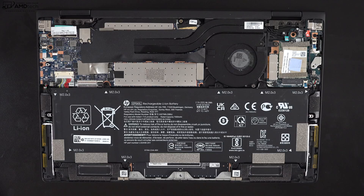The laptop has a four-cell 56-watt-hour battery. My continuous web surfing test over Wi-Fi at 150 nits gave 11 hours and 4 minutes, meaning in real-world mixed usage you're looking at around eight to nine hours depending on what you're doing. Your mileage may vary, so keep that in mind. Battery life is looking good so far on the Elite Dragonfly Max.